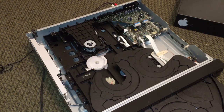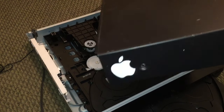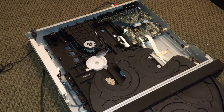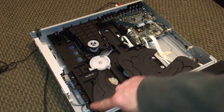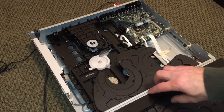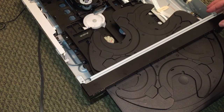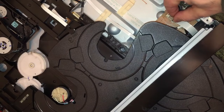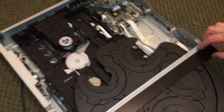Here's what I've done: I've removed the cover. It's kind of cool — it's got an Apple sticker on there, which I didn't put there, but that's something I would do. I've removed all the screws — there are two here on top, one here, and one over here — which allows you to remove the front bezel. To get into this part, I'm going to take the bezel off. First I've got to take a little ribbon cable off — you'll see it right here. I'm going to grab it and pull up. That's the only connection from the front control panel bezel to the unit itself.